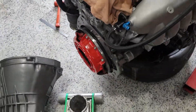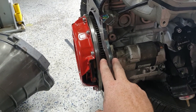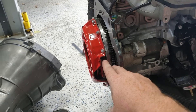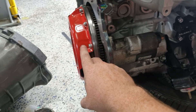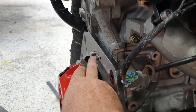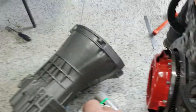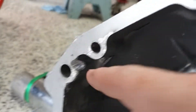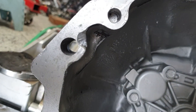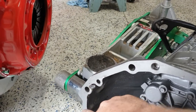Two things I had to address — plus an additional step I threw in for my own sanity. One was the spigot bush. The second was this dowel here — there's a dowel on the adapter plate, and this one comes through in the block. This was fouling against the gearbox, so I had to get in under here and do a little bit of clearancing. No big deal — you can take plenty of material around there. But it was a pain in the ass that wasn't mentioned in the instructions.